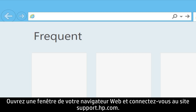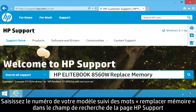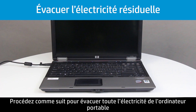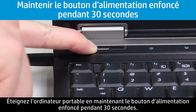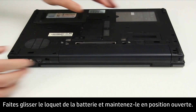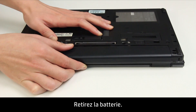Open your Internet browser and go to support.hp.com. Type your model number and 'replace memory' into the HP Support page search field to find steps specific for your computer model. Follow these steps to drain all the power from the notebook to prevent accidental damage to the electrical components. Turn off the notebook by pressing and holding the Power button for 30 seconds. Unplug the AC adapter from the notebook. Slide and hold the battery release latch to unlock the battery, then lift the battery out.